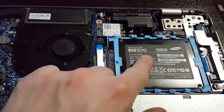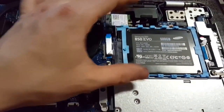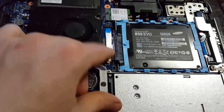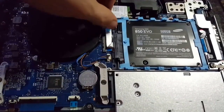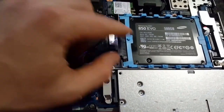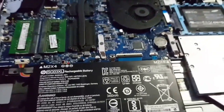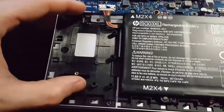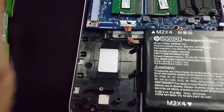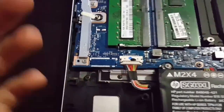The hard disk is right here. I've already installed the SSD — I put a Samsung 850 EVO in there. There's a rubber surround that holds it in place and it's not screwed in at all, so you can grab it on both sides and pull it up. Just be careful because the ribbon cable is short, so you either want to remove the ribbon from the board first — you can tilt that up and pull it out — or just be very careful not to snag anything. The ribbon can then be pulled from the SSD or hard disk.